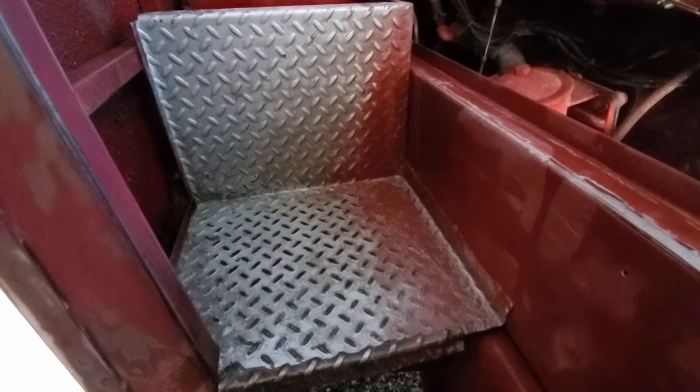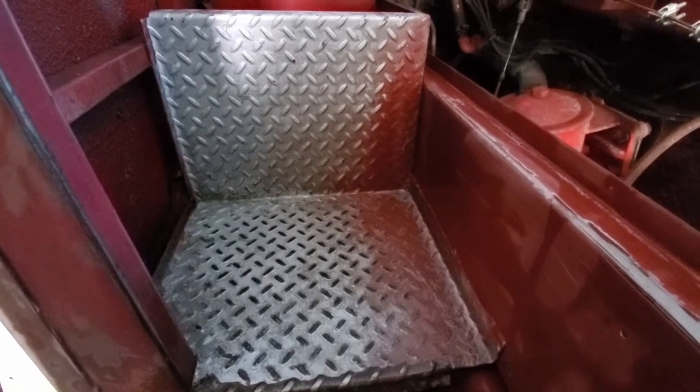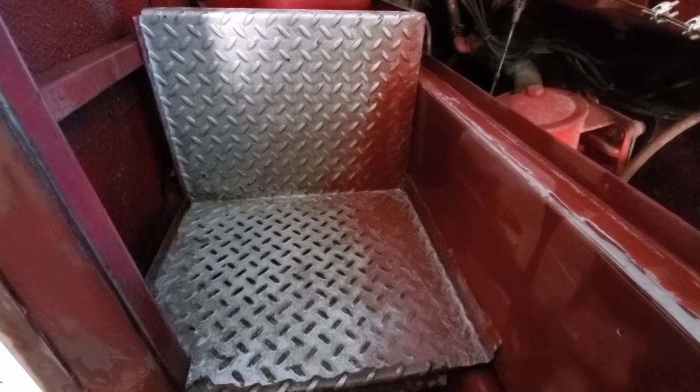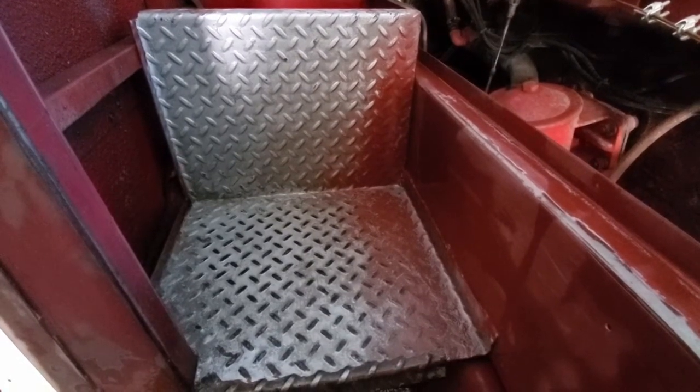It's hard to tell how many layers of paint are actually on these steps. In about five or six years that I've owned the truck, I've put at least two coats of silver on, and it's a '63, so in the 50 odd years of its existence, it's probably had many, many layers of silver paint. The oven cleaner does work to strip the paint off — I was just looking for an alternative because the aluminum silver paint is a pain with regular methods. I think if you have something with only two or three layers, it's a pretty cost-effective way to strip the paint.